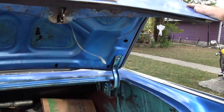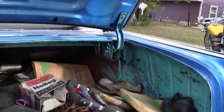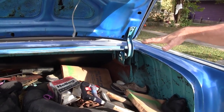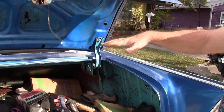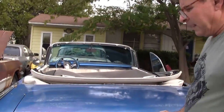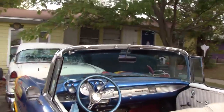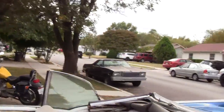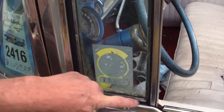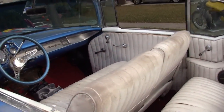Yeah, basically. It's like putting a convertible rear clip on a four-door chassis. It's done correctly. Like I told you, this body on this car would match an original 57 convertible perfectly. And even the doors are convertible doors. And you know how to tell that, right? Yes. Where the sun visor goes, up here, the rain visor. And there's something else. Vent window lock. No lock. Yeah. That's the original Easy Eye glass. Yeah, this is correct. Done correctly, but it's not original.